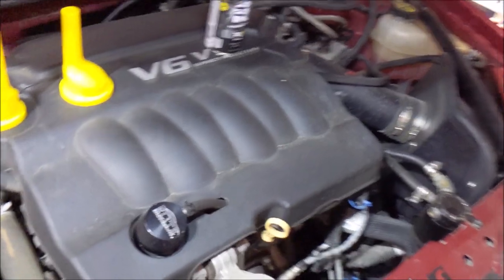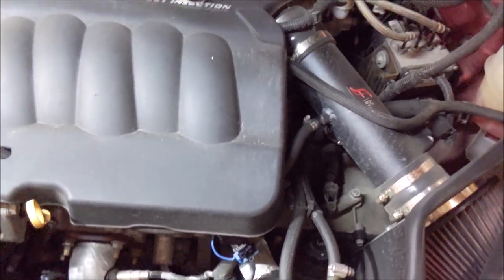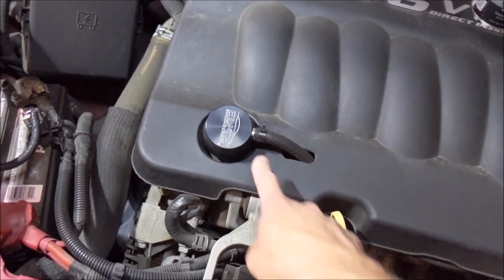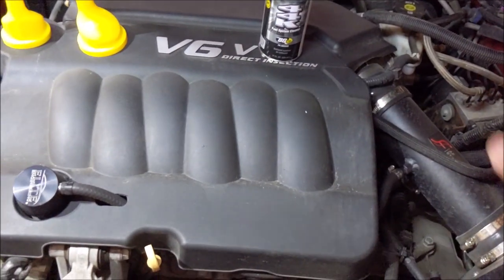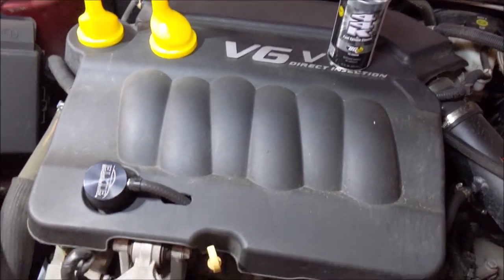Just to catch all you non-subscribers up, I have a catch can plumbed into the dirty side of the PCV, and I have a clean side separator plumbed to the clean side. That virtually guarantees 100% of the blow-by stays out of the intake and thus off the backs of the intake valves.